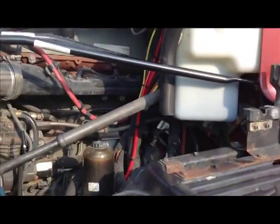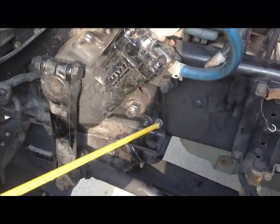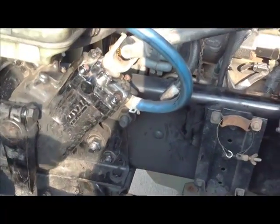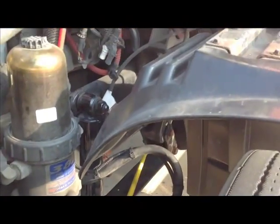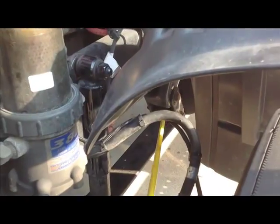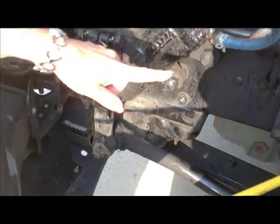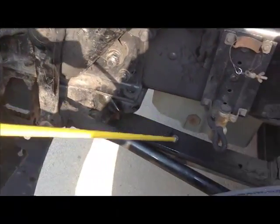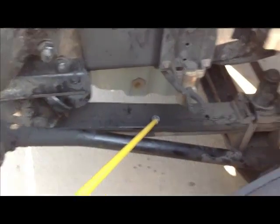Now we're going to go to our suspension. We have our spring hangers and mounts. Okay? There's a big mount here, and then back here in the back, clear back here. There it is. That thing back there, okay? That's also a hanger and mount. So you must say plural. Spring hangers and mounts are securely mounted, not cracked, broken, no missing nuts or bolts. Our springs are in alignment. There's none missing, and they are securely mounted.